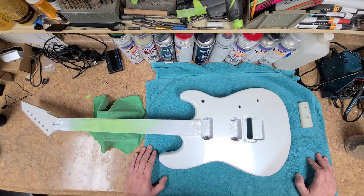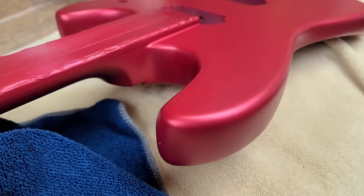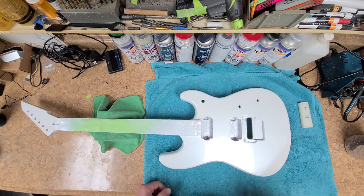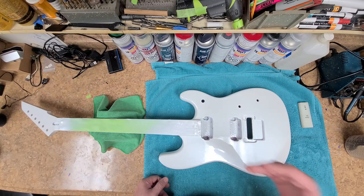Hey everybody, what's going on, Eric C here, hope you guys are doing good. The Devlin was a re-entry red with a micro gold flake in it — that was the last spray out I did. Now it's being changed to a pearl white, and the reason is because these custom paints are a little bit difficult to use with certain colors. The darker the color is, the more of the lighter color you have to spray on top of it to get the color you're looking for.